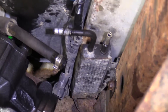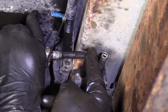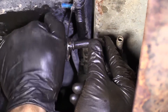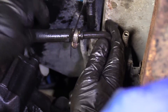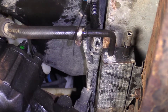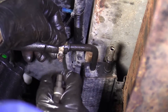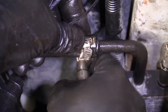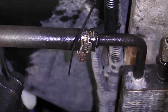Now we're clear to put on our power steering hoses. Take the return hose right up onto there. Give it a little wiggle and slide it right on. You want to get it so it's as close to bottomed out on there as possible, if not touching. Sometimes it's super hard to get it all the way down. Grab the ratchet and snug up the clamp, making sure it's in the same spot it was originally. Once it's bottomed out, give it a teeny bit more and a nice twist — it's not going anywhere.